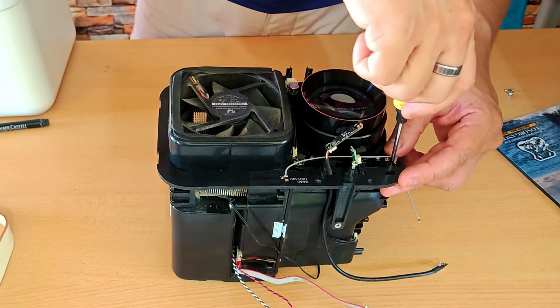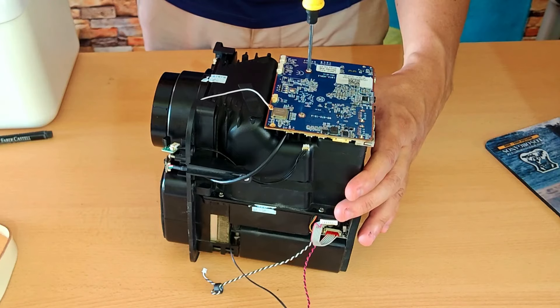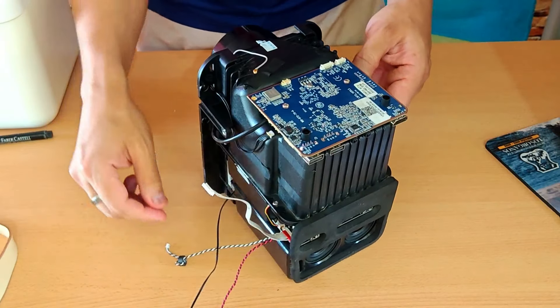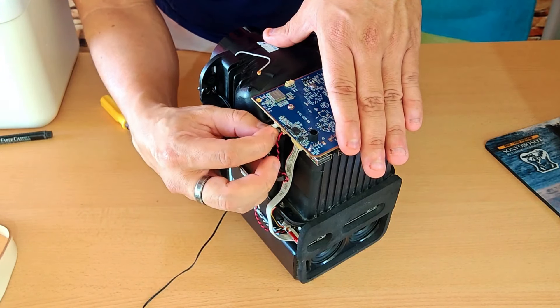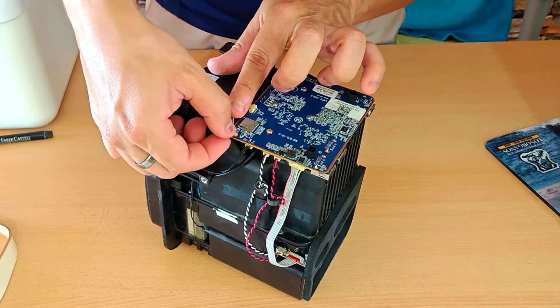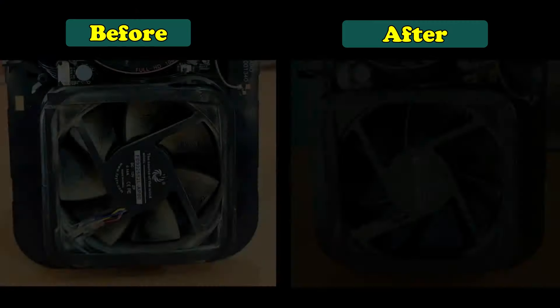This polarizing glass is original and was provided by Whambo's after-sales service — I'll upload the link in the description. Keep in mind that the polarizing glass depends on the projector: there are different sizes for different projector models and even different polarization angles, so it's not just buy and install. One more thing I'll do is clean and maintain it — less than one percent of people do this to their projectors. Now you know the consequences of not doing it at least once every three years.